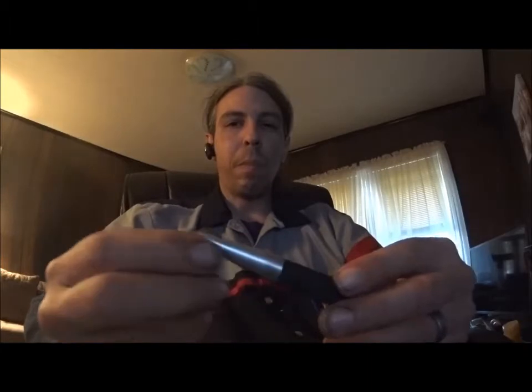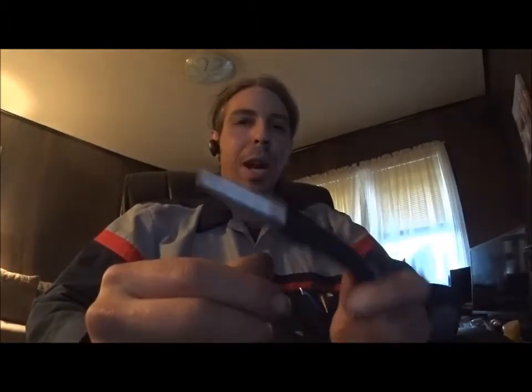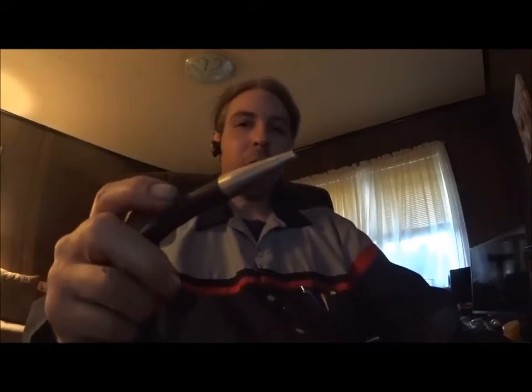I did this so that I can hook up to different size lines — if I wanted to go into a vacuum line or whatever. It's a conical design, and it was made on the lathe. I've made multiples of these out of aluminum and some machinable plastics I have in the basement. They work really well — I use these on the smoke machine a lot, because sometimes I want to go into the intake manifold, on the vacuum hose coming off the booster. The ones that come with smoke machines are usually small, so I've made some that are 3/4 inch diameter up at the top and they'll easily fit half-inch hose or whatever you need. It's just a little hobby — machining — but it comes in real handy with automotive stuff.